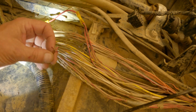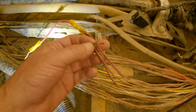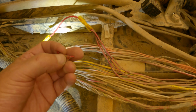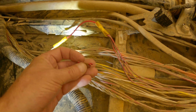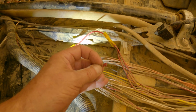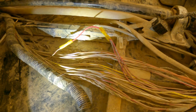And here's the little culprit. They had this little wire coming into a brass or copper lead, and then these 4 lines were soldered onto this. Well, what happens is water gets in there and corrodes, and when I took this all apart, mine looked fine until I inspected it closer, and then there was green coloring on one of the wires down here at the bottom, which tells me that, when copper starts corroding, it turns green.